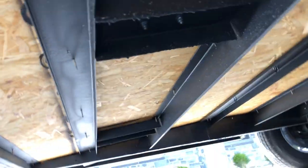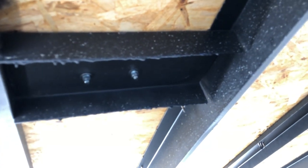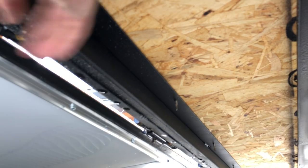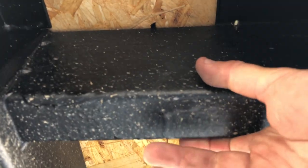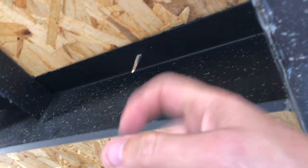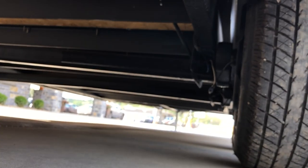For folks not familiar with the beaver tail, let me show you how it works. The D-rings — I like how they're made. If you look underneath a lot of them, they're just made out of a piece of flat; this is a lot nicer done. This bumper is also made out of tube steel, not formed like a lot. Not only are these all undercoated, but this outrigger here is made out of tube — same as the mainframe — versus a lot of them that do the outrigger just out of a floor cross member, which isn't going to be nearly as strong. That's very important. You'll also notice on the axle — that's torsion, not a spring axle as I was talking about earlier.